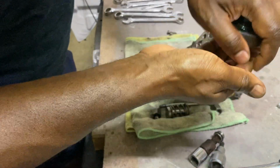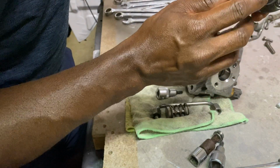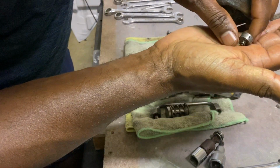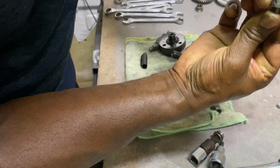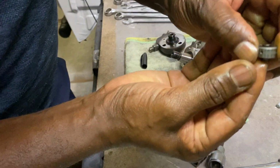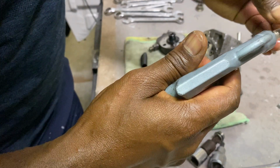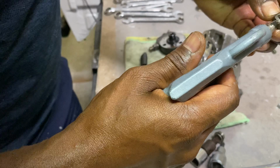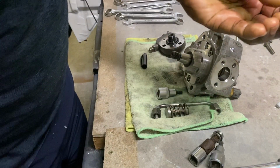As you can see, that thing there had lots of dirt stuck in. So it was stuck open like that, guys. Stuck open like that. So what I did was, got the hose and blew it at each hole. Give a good clean. Put a bit of diesel.